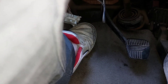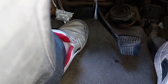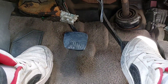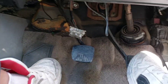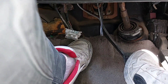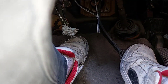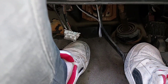Let's go forward a little bit — the first gear kicked in quite smoothly, the gear is engaging. Now let's put it in neutral. It stays down, so I gotta do that maneuver again. Reverse is not getting, so I kick it hard and the gear kicks in. First gear seems to have no problem kicking in — everything's working fine there.